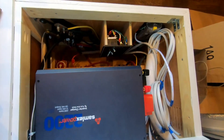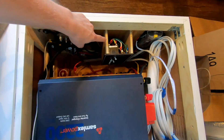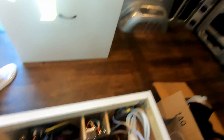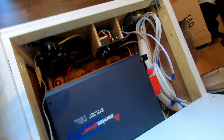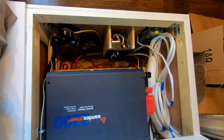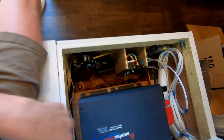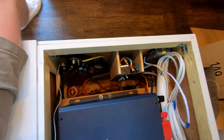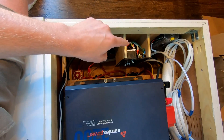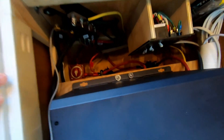We have two sources of energy: the 12 volt DC system and the 120 volt AC system. Everything is hooked through multiple layers of fuses — by the time you get out to things like the lights and the fridge and any other peripherals, there are two or three layers of fuses and breakers preventing those things from overheating and preventing wires from melting. I tried to make this system extremely safe. We have four 100 amp hour batteries totaling 400 amp hours. We have bus bars which link to the 120 volt fuse box and the 12 volt fuse box, and breakers in between everything on all the larger wires.